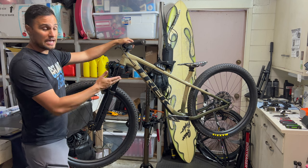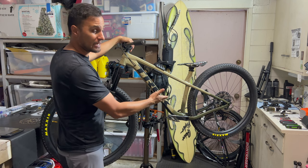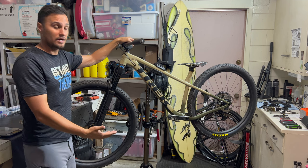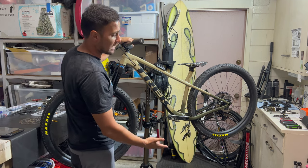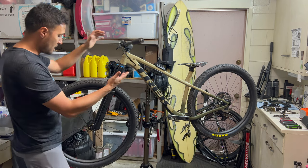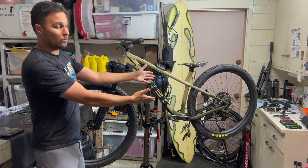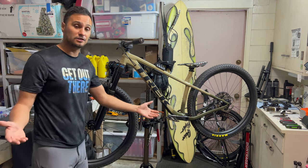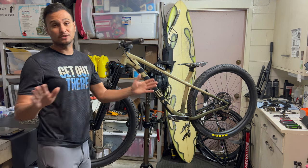And I also found that having one brake on a bike that weighs 4 pounds more than my previous bike is not enough. And I have the XTR 2-piston caliper, and the bike came with a 203 in the front and a 180 in the rear. Well, I stuck a 160 in the rear, thinking that the bike would act just like my old one. Well, I was completely wrong.